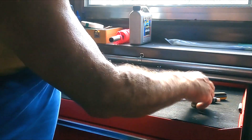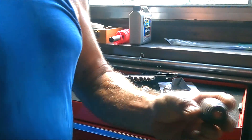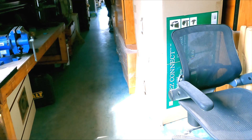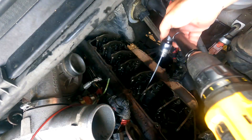Just to show you the cup that came out of the third cylinder on the driver's side — this is the one that's cracked. There's about an inch-long crack. It doesn't look like much, but under pressure it pisses fuel into the coolant and pressurizes your system. The bad part is that same cylinder's injector also had a very bad o-ring.